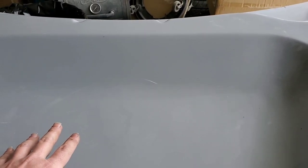So we got the hood back in and I'm going to show you guys a couple of things that you won't have to worry about on your hood, but I have to. My hood came without the drain holes — there should be two there, one about right here, and one on that corner. And if you remember in my last video when we unboxed it, I felt like there needed to be something here that was on my buddy's hood. So with that being said, I spoke to BMC and their person who runs their social media on Instagram, and I reached out to them via phone and talked to Mike, the owner of BMC Customs. We're going to open that up for the heat extraction, open that up, and then drill some holes for the rain drip.